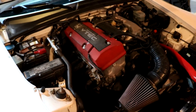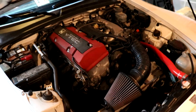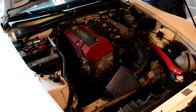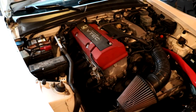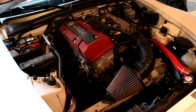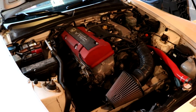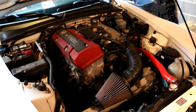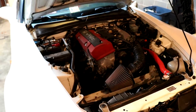When the engine was pulled, it had its clutch replaced - another thing that was appealing to me. It has an AP1 flywheel and also a competition stage 2 clutch. The previous owner planned on supercharging this eventually, so that's why he went with that heavy-duty clutch. It's taking me a little bit getting used to. It also has different engine and transmission mounts - the Innovative 75A, which is a mild, not full street, not full race, right in between. The only complaint is that at idle, it has a slight vibration in the cabin. It has the stock air pump removed, so it has the forged block-off plates and Izze-Racing simulator, which gets rid of the check engine light. Apparently it's cheaper than buying a new air pump.